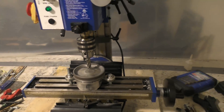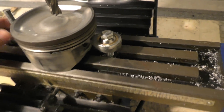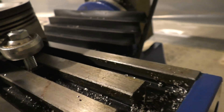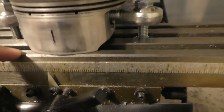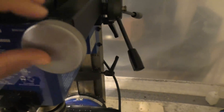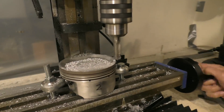For machining the actual pistons I'm using my mini milling machine with a half-inch end mill. The piston was a difficult shape to put in a vise because it doesn't have any flat ends on the side, but luckily I had ball joints that fit right into the wrist pin — a pretty good fit. Putting these two ball joints on either side and bolting them to the milling machine was a really easy way to fixture it. The pistons have a machined surface at the bottom so they sit pretty flat. I lowered the mill until it touched the surface, then lowered it by 0.75 of a millimeter and took that off the entire top surface.